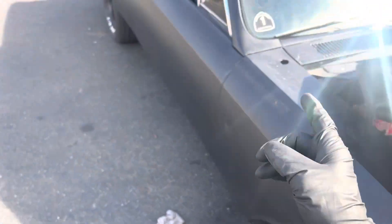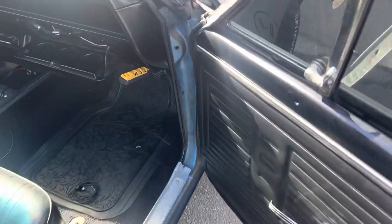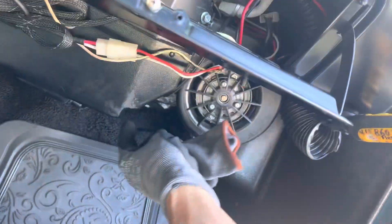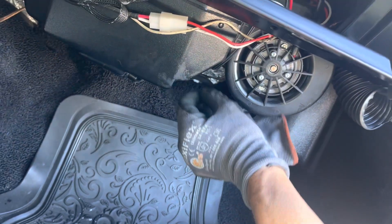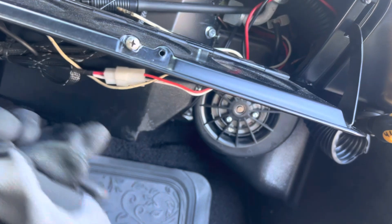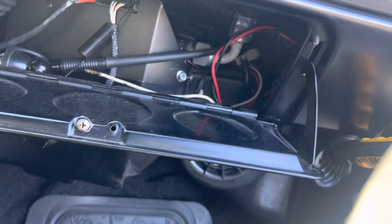There's an electronic device — the thermistor — in the airbox. This controls the temperature for when it's going to cut in and out. See that little metal line right there — it hooks up to the wires right there. There's a thermistor right there that determines at what temperature it cycles. It was working fine, but now it's not. It went out of calibration after about 40 minutes to an hour of use, and all of a sudden it started kicking out too soon.